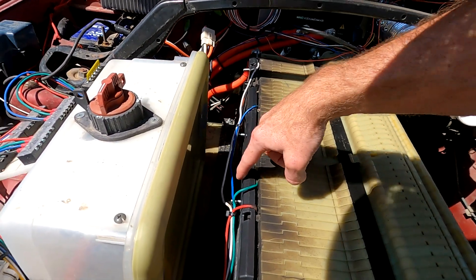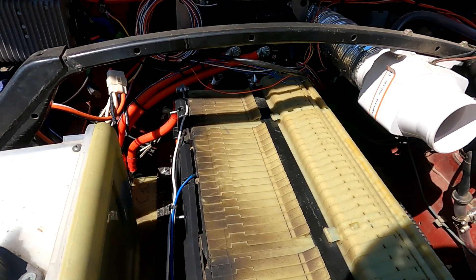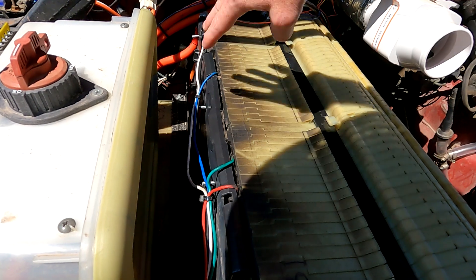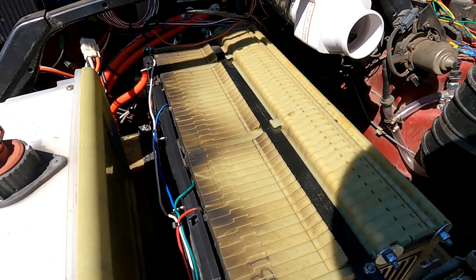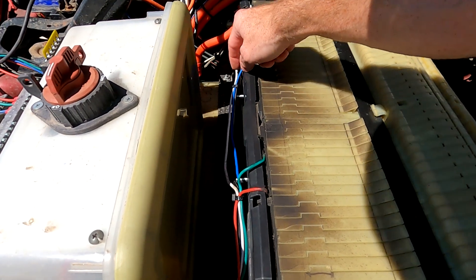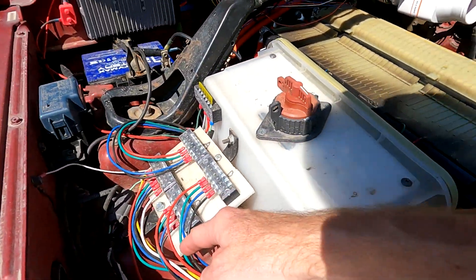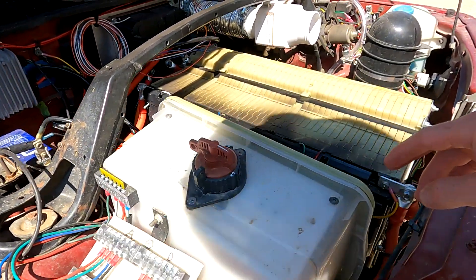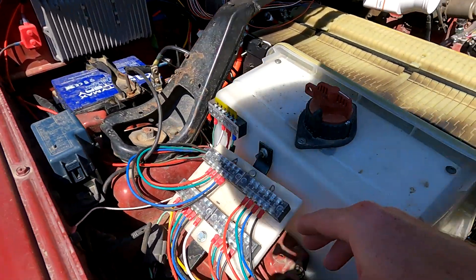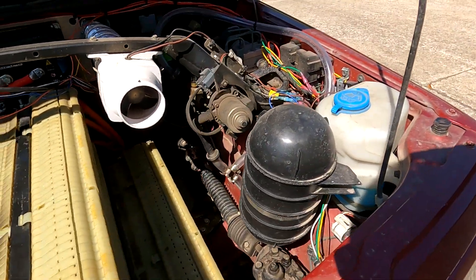I only had to put jumpers across those modules. A plastic cover is protecting most of it, but just along the edge I've got aluminum. The reason it's all black is I took some rubber paint coating and painted all the exposed aluminum on top so that it's non-conductive and has some protection from shorts. These wires sticking out are my poor man's battery monitoring system leads that run over to a little block where I can check voltages. I don't have one on every cell — I have them every six cells, so each one should have roughly 24 volts between them, and I check them periodically.